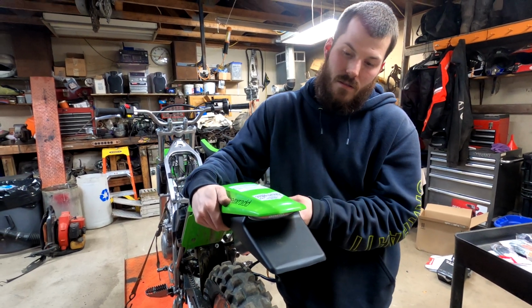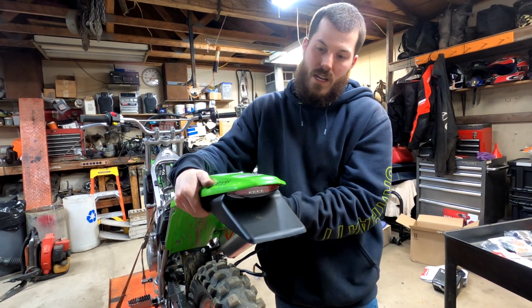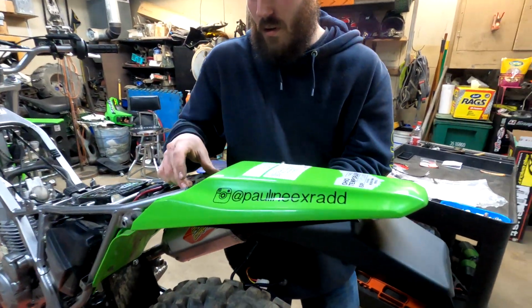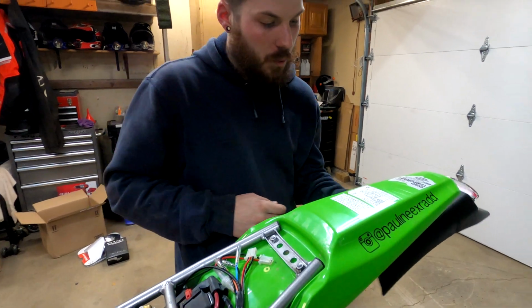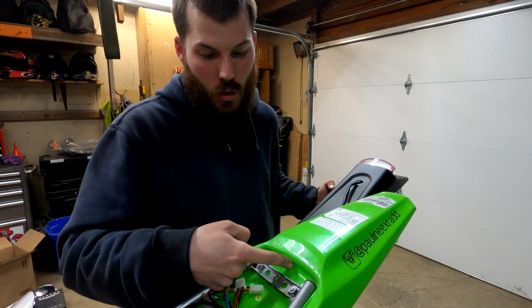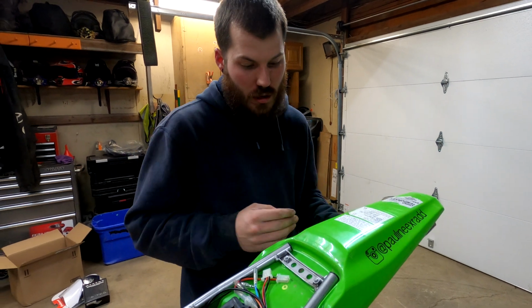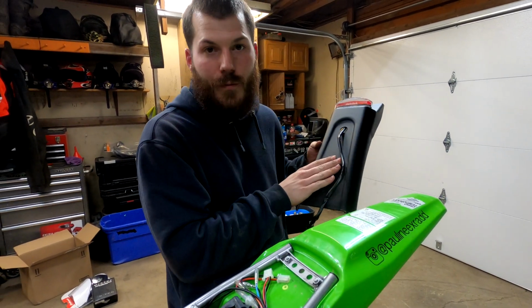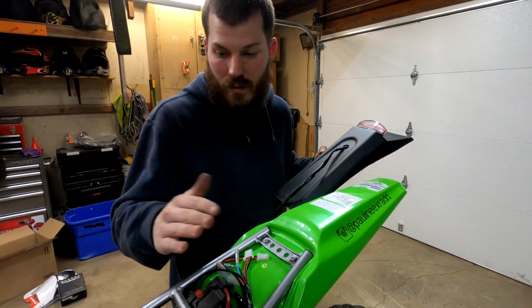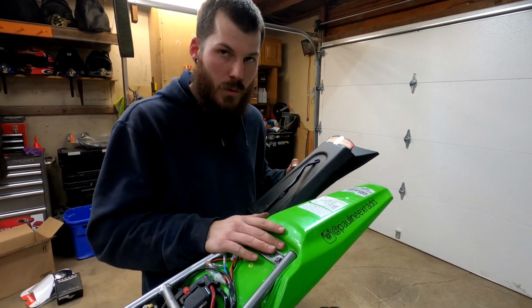You're still gonna see that tail light from behind, especially when we hit the brakes. And it kind of protects it a little bit more, you know what I mean? In case something comes down here. That's just the way I'm thinking, and I get to use these factory holes as well. The other thing I'm thinking, guys, is this wire has to come up through somewhere, right? So right here, I think I'm gonna drill the hole to have the wire come right down into here, because tucked up underneath, by the time you're right here, you still have the rest of this fender blocking it. So not much stuff should come up into this. All this stuff is waterproof to begin with already, or at least water resistant, so I'm not too concerned about it, but I think that's the route we're gonna go.